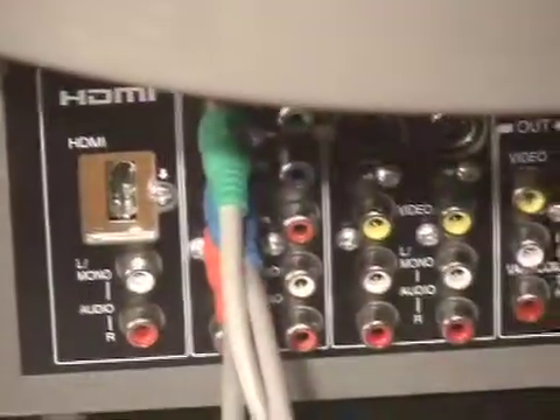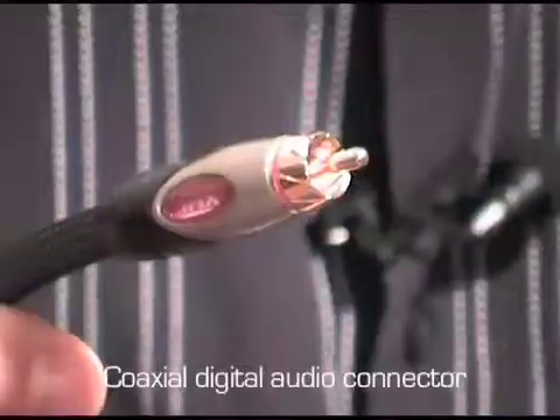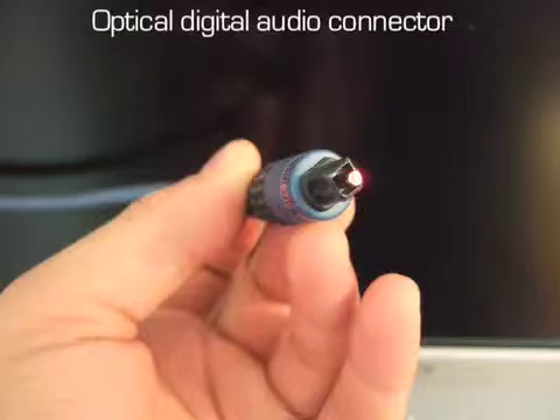Important to remember, that's a video signal only, so you still need the two audio cables. We went from one cable to two, to three, now we're at five. There are a few other cables you can use to replace those two audio cables: a coaxial audio which is like the RCA connector but takes digital signals, and an optical one which uses light — a little D-shaped connector that spits a little red light out the end. Where are you going to want to use component? On a DVD, and especially if you have a high-definition television. Anything using high definition needs component at the very least because it carries more signal.